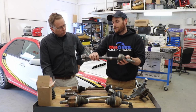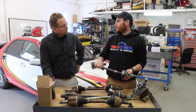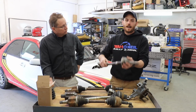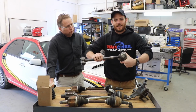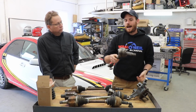If you put massive suspension travel in your normal car or pickup trucks, you see it. People put lift kits in pickup trucks, and then you got this, and you're snapping axles. Or we see it here at the driving school a lot, high steering angle, which you can probably even hear on the video. It's not a very happy noise.